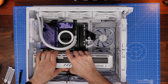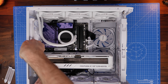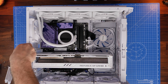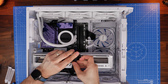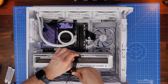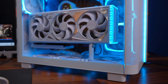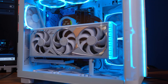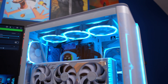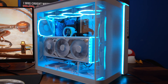Don't forget the GPU as well. When you slot the graphics card into the top slot on the motherboard, get the power cable ready. For a 40-series card, pull the power cable from underneath — this lets you run it in a way that avoids putting pressure on it, which is important. Run it through, plug it in, and fully seat it. I like to power it on at this stage to check everything's running properly, and then you can cable tie and secure everything at the rear, then go about installing Windows and enjoying your fully built system. Hopefully you found this useful — check out the links in the description to the build guide and other related content. This has been The Provoked Prawn.